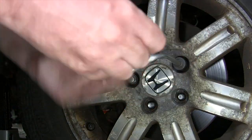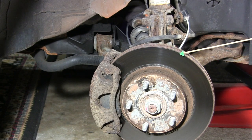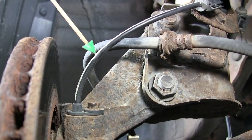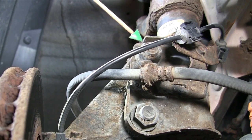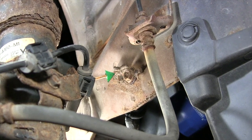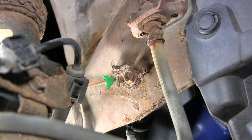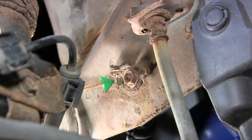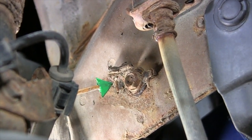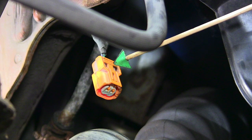Behind the wheel and tire is the brake system with the caliper and a brake rotor. But I was interested in this cable that runs behind the brake rotor. It is attached at one end to the wheel hub with a small bolt, secured by a pair of plastic anchors snapped into a bracket on the suspension, and then attached at the other end by a metal bracket to the body. The bracket is gone — it actually rusted right off the body. All that's left is a 10 millimeter bolt, which allowed the cable to dangle freely and get yanked out of the connector.